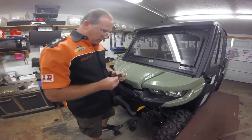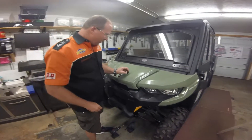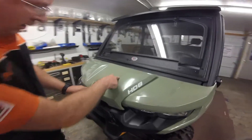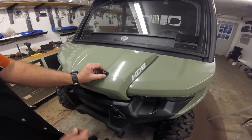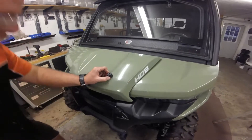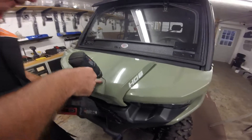In the bag you're also going to have a bumper with a screw and a nut inside. This bumper is going to need to be located on this body line and this body line — it'll sit right up there on top of the fender. What we'll need to do is take it and put a 3/16 inch hole right there for mounting the bumper.